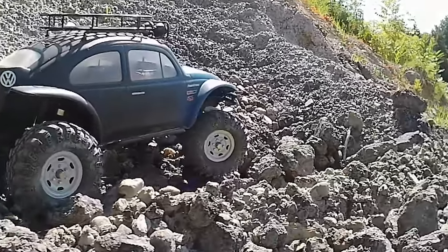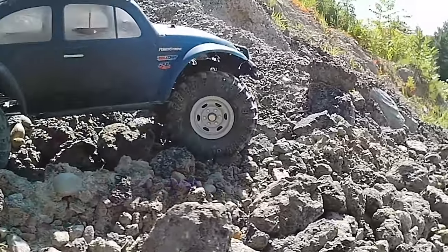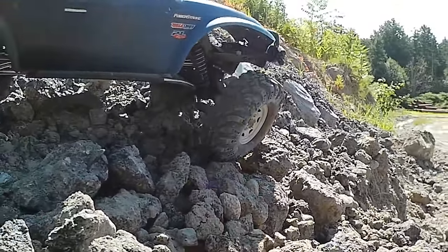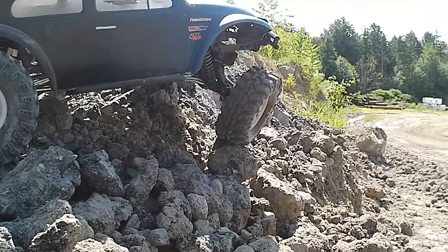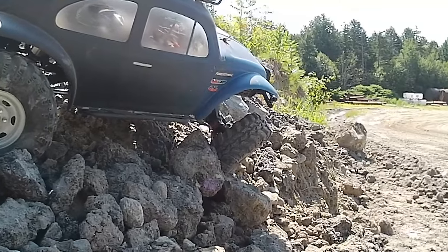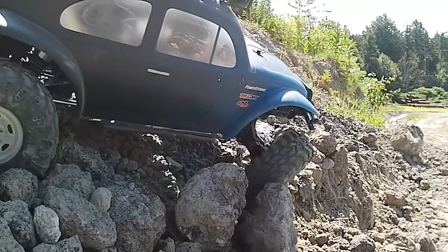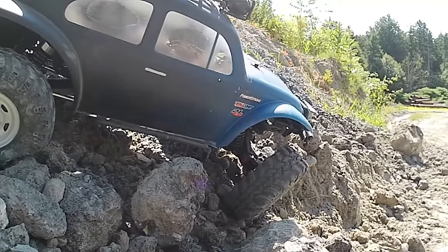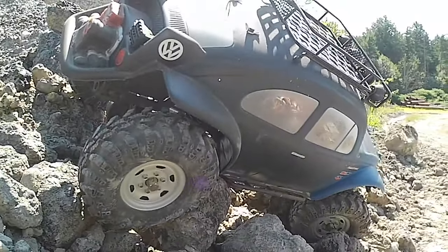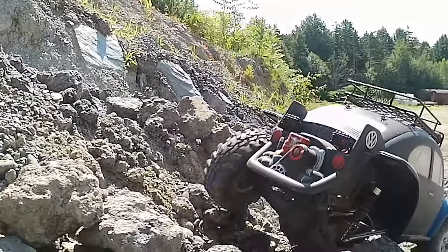Back to the shocks — once I got that metal piece tapped out and got that O-ring and small plastic bushing out of there, that left one orange O-ring inside. I reassembled everything and they now flow completely smoothly and freely with no obstruction at all. Before I did all of this, I trimmed about an inch of coils away from the shocks, which let it ride considerably lower. Now I've got probably three-eighths of an inch of travel before it bottoms out against the bump stop seal on the inside of the shock.